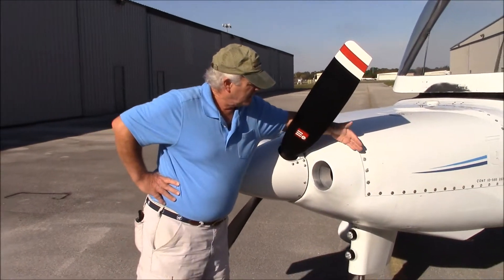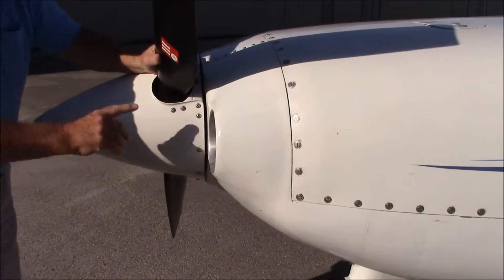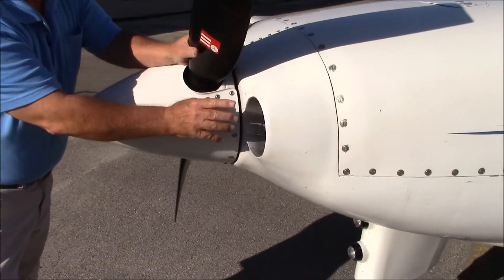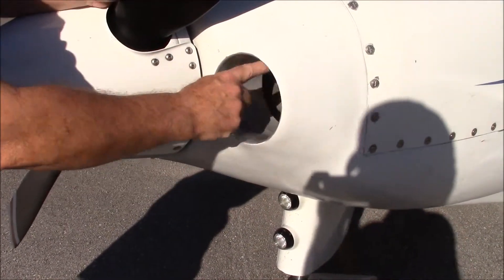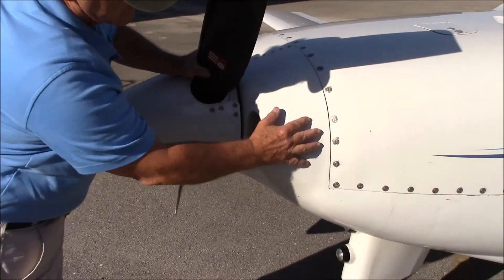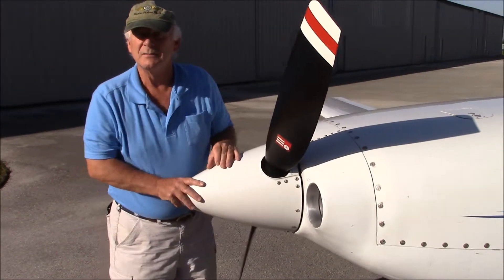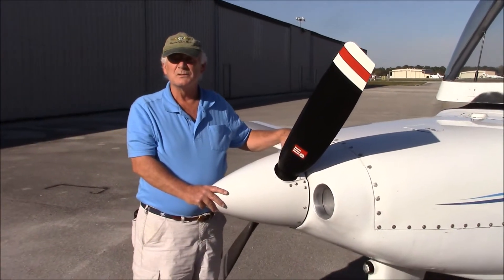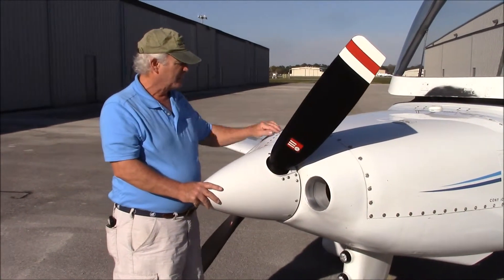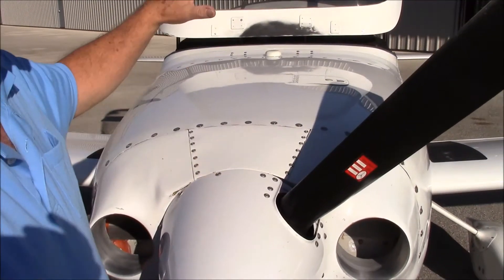In the process of doing that, the front of my whole cowling had to come out further — the extra three inches. Originally, the airplane was designed with just a triangular-shaped area for the air intake. I went to a Venturi system, which was developed by some guys for the RV program, and this is all modified with fiberglass. One of the fallacies in the original design is that pulling the engine would be extremely complicated because this piece came all the way across the top. So I made a removable piece here, which a few other people have done, so that if you do have to pull the engine, you can lift it right out.